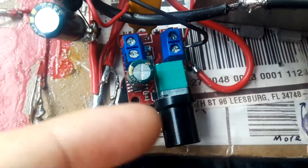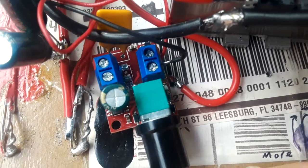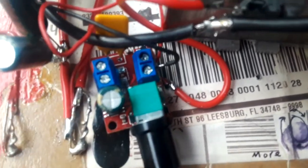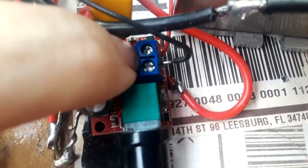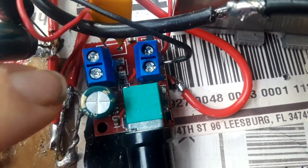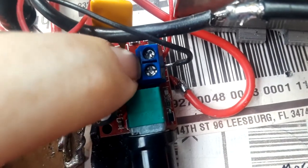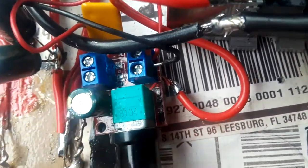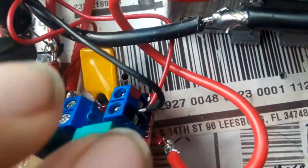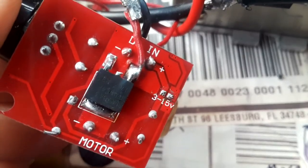So I can adjust brightness manually just by turning a little knob and get whatever brightness level I want. Here's the pulse width modulation module I'll be using — I've got several of these. Normally your power comes in here with negative and positive, and then power comes out. What I'm doing is putting power on the input and then the output hooks up to the other side. To use this on the screen is the same principle — you put your power in and hook up to the gate of the MOSFET and send that signal to the screen.